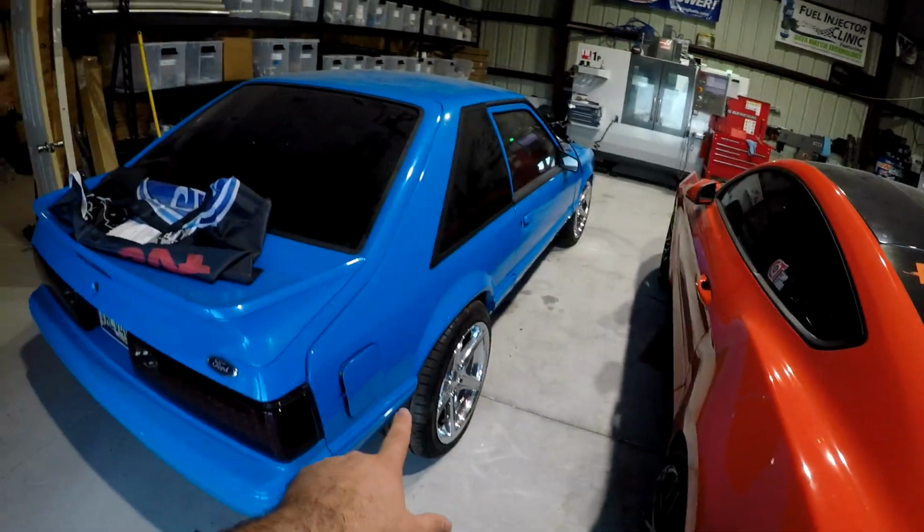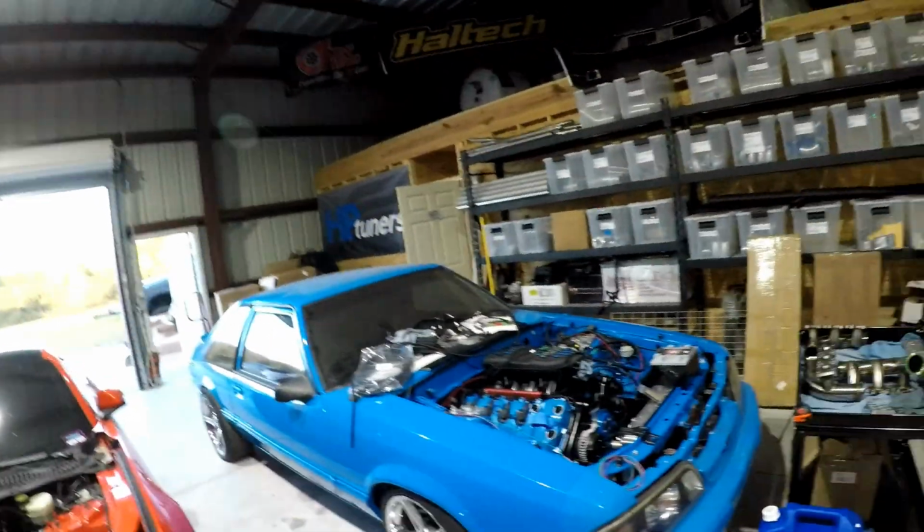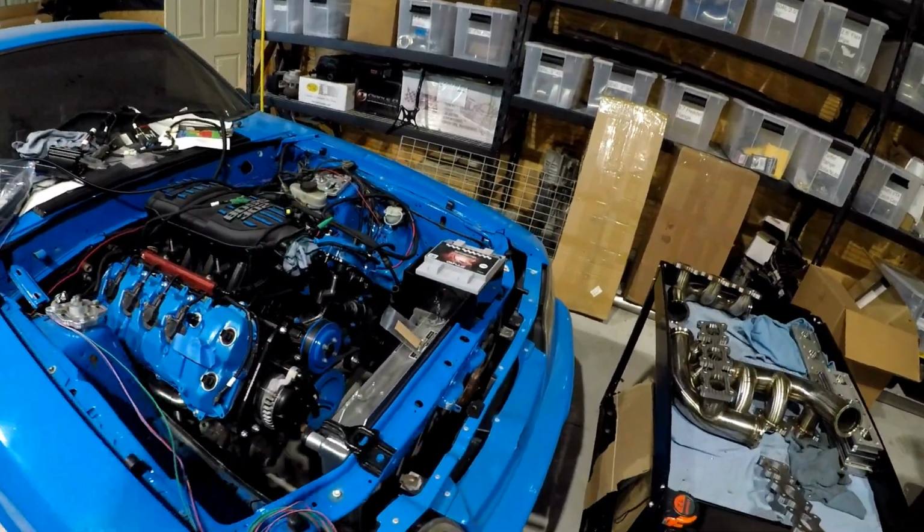One thing we've done is we went back around and fixed all of the tires and wheels. These wheels were really old and kind of cheap, but we just wanted them to stay on because we like them. The problem was the chrome was peeling off, which caused them all to go 100% flat. So Tommy took all the tires back off and used a flapper disc to grind all the chrome off the inside, then wire brushed them and cleaned them all up so that the tire could actually stick and not leak. Other than that, it is looking good.